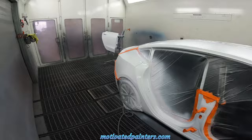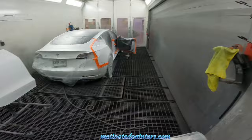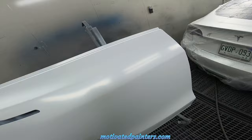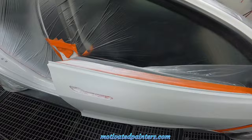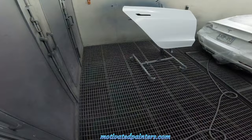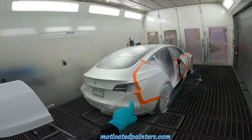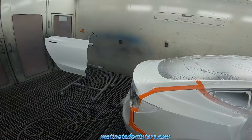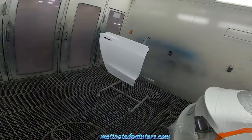Just a little circle there. I'm going to put the blowers on for nine minutes, let this dry, and then put on the mid coat. So I'm going to do the same thing because this is going to need a little extra pearl. I'm going to do probably two coats, let it flash off, and then another coat, but we'll see how it looks. Usually with this formula it's one light coat, another light coat, and it's done — but this one seems a little yellower.